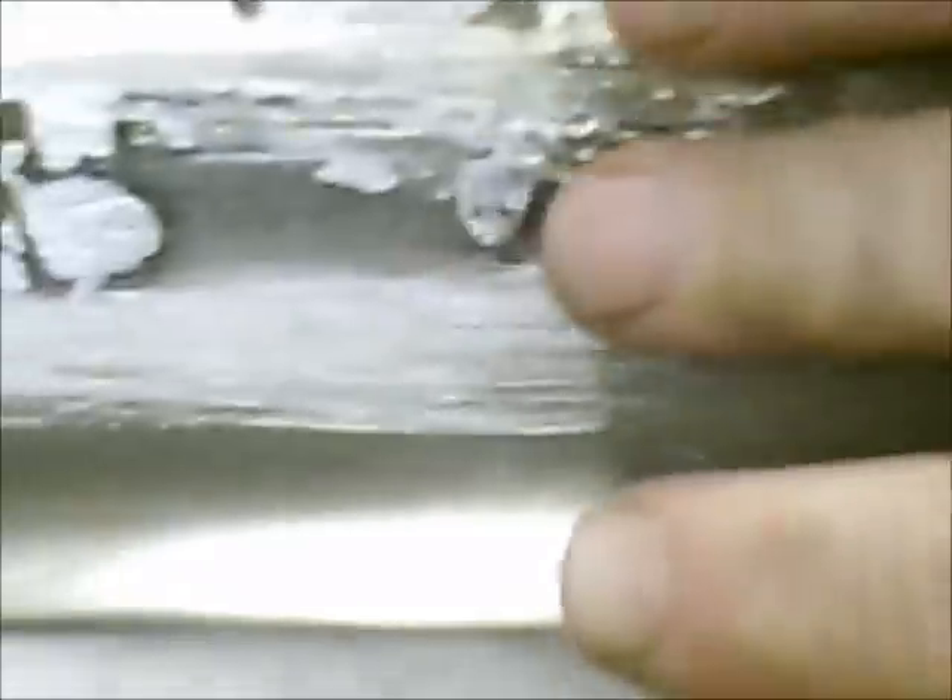Let me give you another bird's eye view of how it looks now. Once we get this machined down a little bit more with the file, I think I'm going to get some more of these other real high spots down. Then at that point I'm probably going to take either my DA with some 80 grit or something of that nature across it. I'll have my respirator and stuff on — I need to get some new filters for it. That's the only reason I'm not doing it this evening.